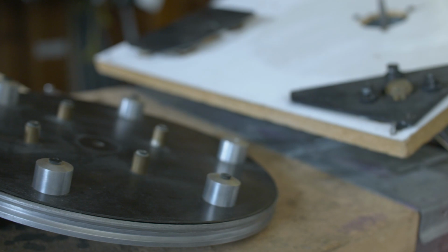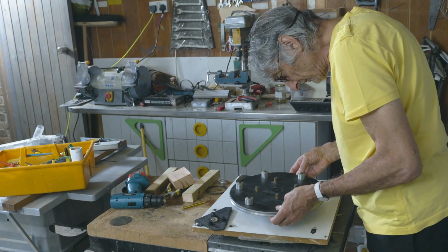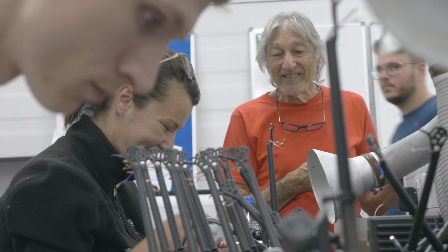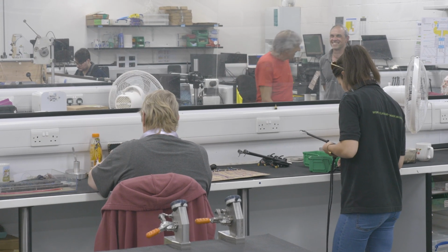In making a heavy plinth, it became obvious that I was just creating a way of transferring the hum from the motor even more loudly into the rotating turntable and into the record. So I then did the opposite. I took all the concrete off, got a lighter bit of chipboard, and suddenly the hum got a bit better. And I started to notice sound quality changes as well as getting rid of just the hum itself. That was the beginning of Rega's interest in the fact that the turntable has an influence on the sound quality. And turntable engineering captured my imagination because it's a continuous learning process.